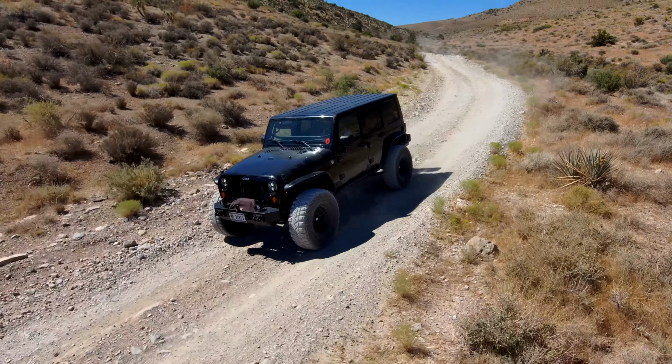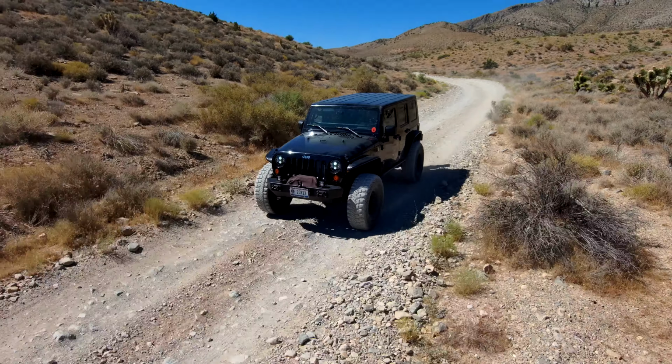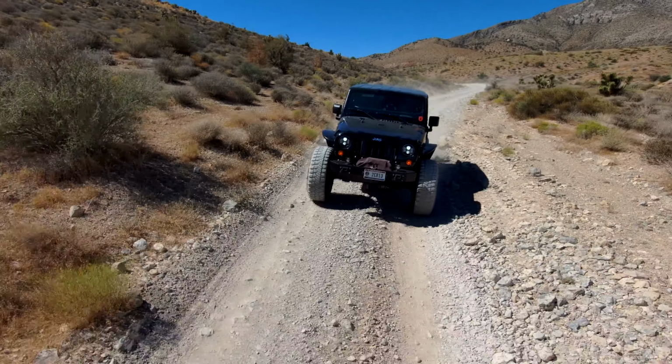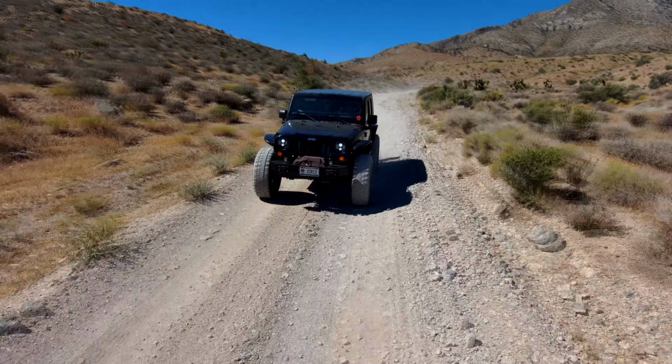And it doesn't cost dramatically less than an LT1, because if you think about it, pretty much you got the same amount of labor, almost the same amount of labor. You have almost the same amount of parts. Now, we don't run the engine oil cooler standard on the 5.3. The 5.3 does have slightly less compression. I think it's 11 to 1.